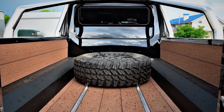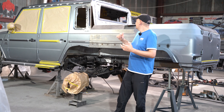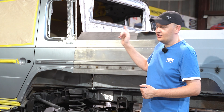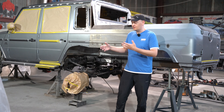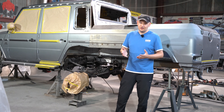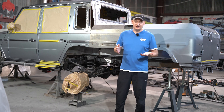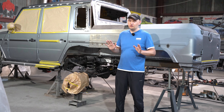In terms of the rear frame, we're on top of that too. It's really slim on this new G-Wagon, part of the whole weight-saving scheme. We made our section a bit thicker, with internal reinforcements inside the frame, totally hidden from view. We've been welding frames for around 16 years. We've even stretched a G-Wagon by five and a half meters and made it a limo. This project? Maybe another three weeks or so for the welding work, getting the body just right.